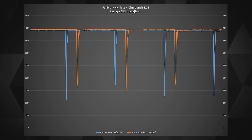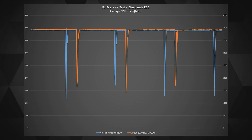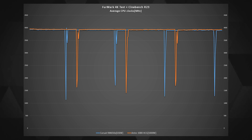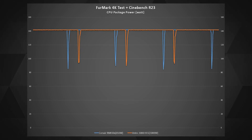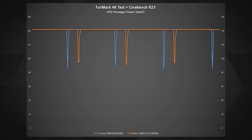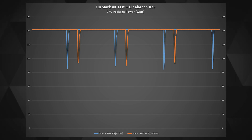If you had doubts over CPU performance, the CPU clocked just slightly better on the 1000W Antec compared to the Corsair 650W, but the difference was about 1 to 2% maximum — minor but a difference nonetheless. Power consumption was about the same, ranging around 141W on both PSUs. So a big zero here in terms of performance difference — and I've cleverly shared CPU stats on the 650W power supply in a video that was meant to be about the RTX 3080's performance.